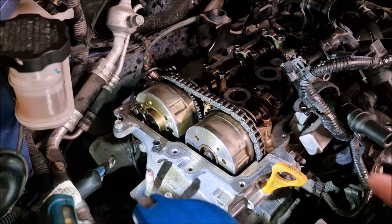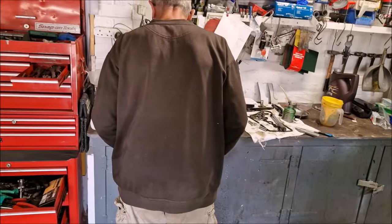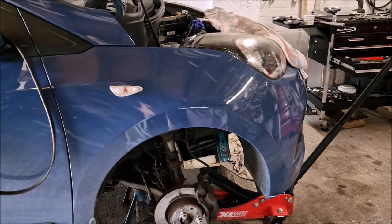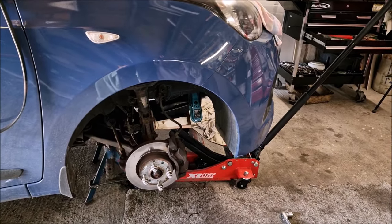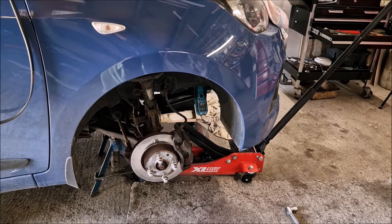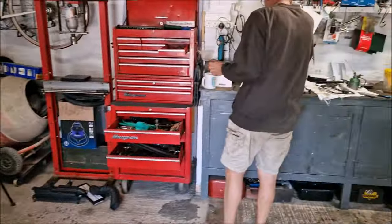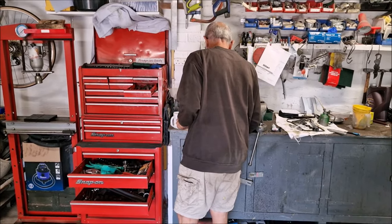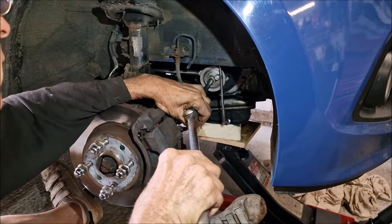So you've turned the engine over twice. Nothing seems broken and it's lined up. So you've written the torque setting down. Yes, for the crank pulley. What is it? Well, I've given a big range of 55.9 newton metres to 61.8 newton metres. And then plus 38 degrees to 42 degrees. Oh, so 40 degrees, eh? Yeah, bugger! I mean, that's a different kettle of fish there, Gromit.